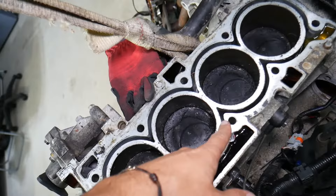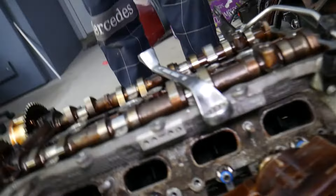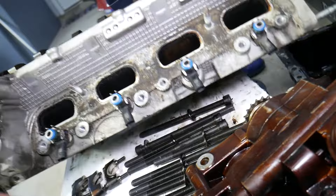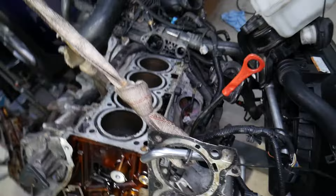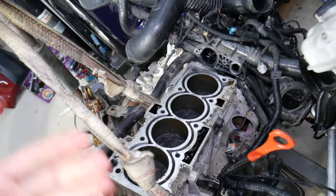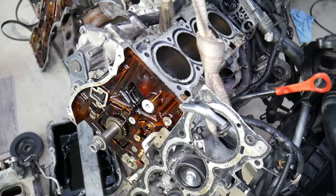If you just add coolant and start driving, you can end up having an air pocket inside the engine block. Let me flip the cylinder head to show you something. The cylinder head has multiple coolant passages inside. Right here and everywhere here, you can get coolant trapped in these holes in the cylinder head. If it gets trapped, coolant will not flow freely between the radiator and the engine, and that can overheat the engine, causing bubbling and coolant overflowing from the overflow bottle or the radiator.